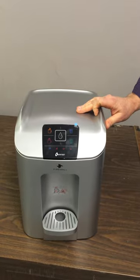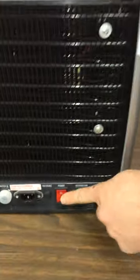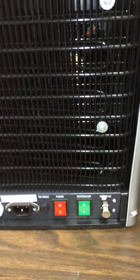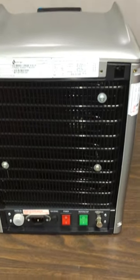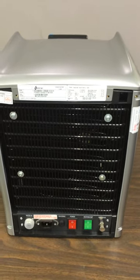One of the main issues with this is when people first turn it on, they turn on the power and they turn on the heater and the compressor without filling the unit with water. So what happens is the water tank heats up and the breaker trips because there's no water in it, and the breaker shuts off before damage can be caused to the hot water tank.